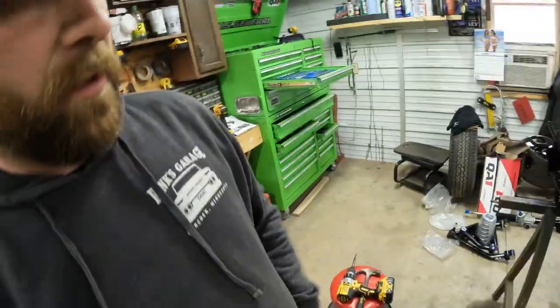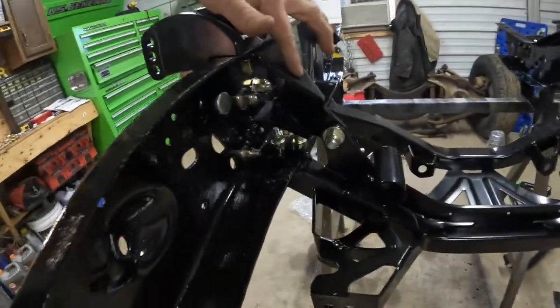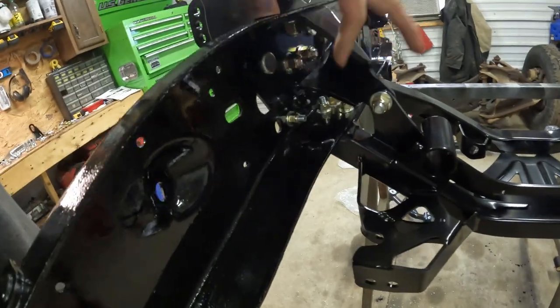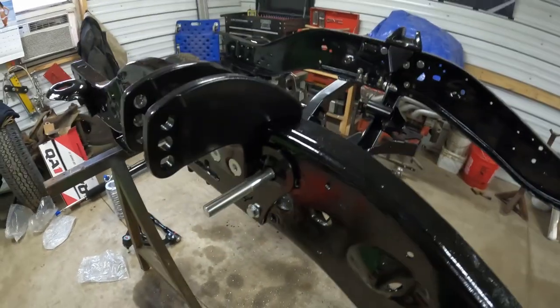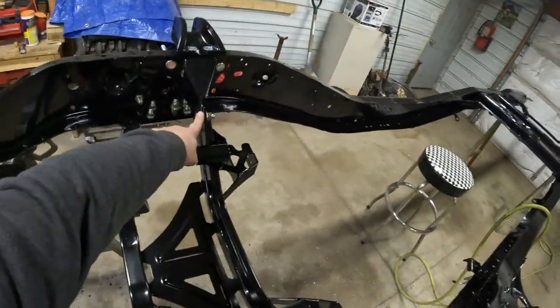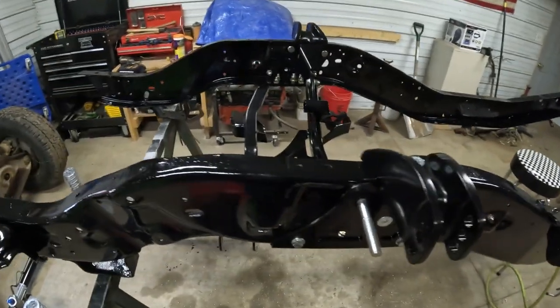I believe that's the end of drilling holes too. I'll finish tightening these with a wrench — it says to tighten them to 50 foot-pounds. One thing I did not notice when I tightened the bracket on: these two studs got knurling on them and it slid them out. I had to take a hammer after I had this tight and pound them back through — the frame it's a little bit oversized a half-inch, so now the knurling is into the frame and the back bracket. This one was a little tight, I actually had to put a clamp across the frame and bring it back just a hair. But not bad — on to the A-arms.